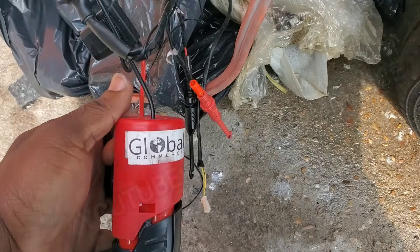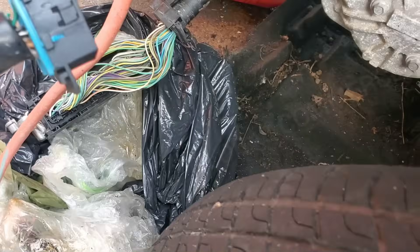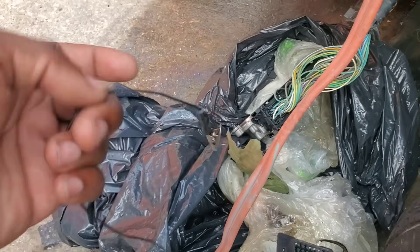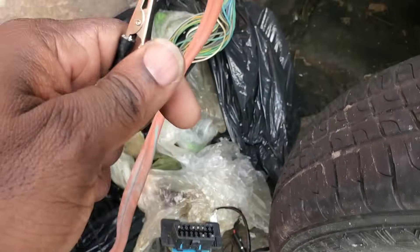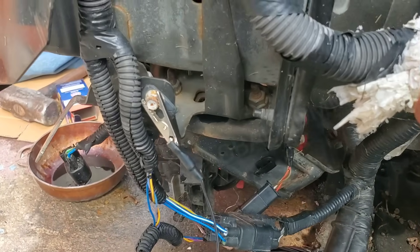It functions off of the Milwaukee M12 platform, so you just plug it in and it's powered up — the lights are on. I'm going to put it in the shade so we can see what's going on. The first thing I'm going to do is find the ground anywhere, because for valid readings you need to be connected to a common ground on the vehicle. This spot looks good enough — I'm going to connect up right here. All right, so we've got our ground there.